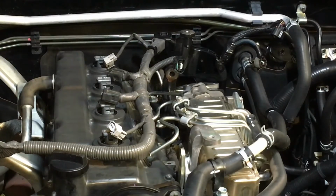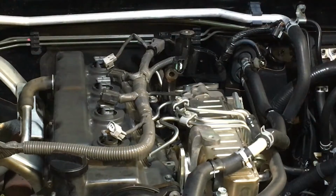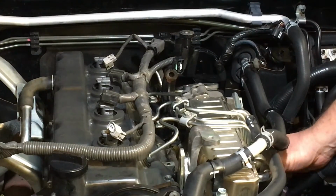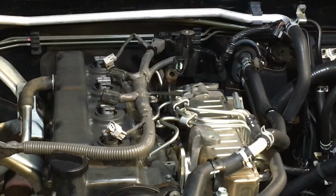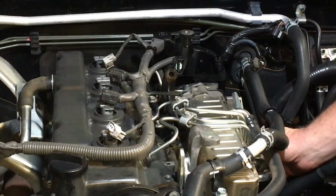So working from the outside, the bolt. This is the bolt here, that's what it looks like. It's got 2 dots on the end. Remember this stay here in part 2 that we moved out the way? We're putting that back now, right? So have your 3/8 drive ratchet handy. I prefer the 12mm deep reach, that's why I've got something to hold on to and guide it in. It's in a bit of a hidden spot down there.